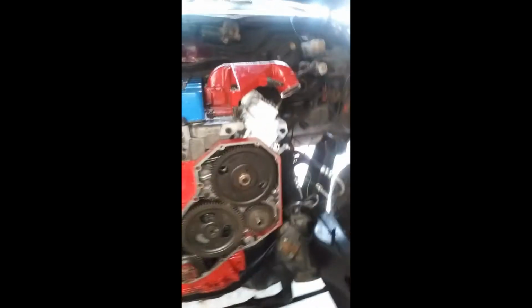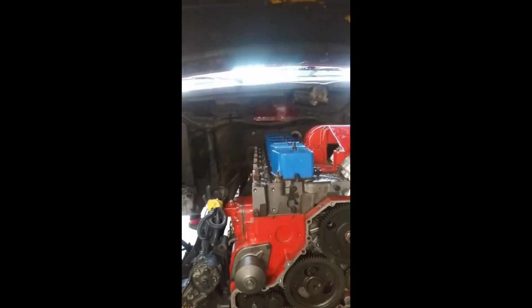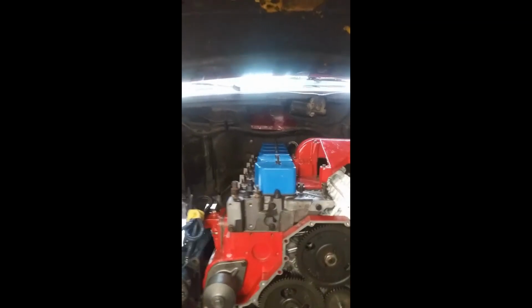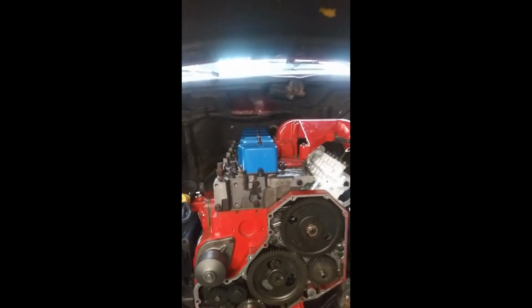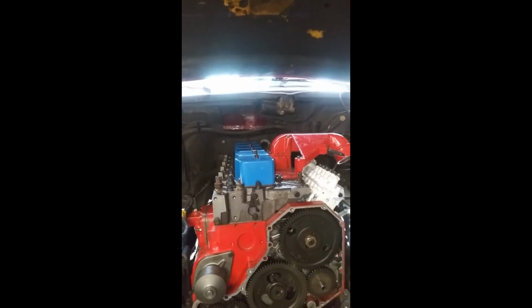One thing that I did not find out until yesterday when me and my buddy Steve were dropping this engine in is you will absolutely, especially if it's a ZF5 4x4, need to relocate your transmission crossmember. It sits about an inch too far forward, so you'll have to cut open a little bit of the floor and make it sit a little further back in the cab so you can actually shift and do all that good stuff. Because shifting gears is important, especially in a manual.